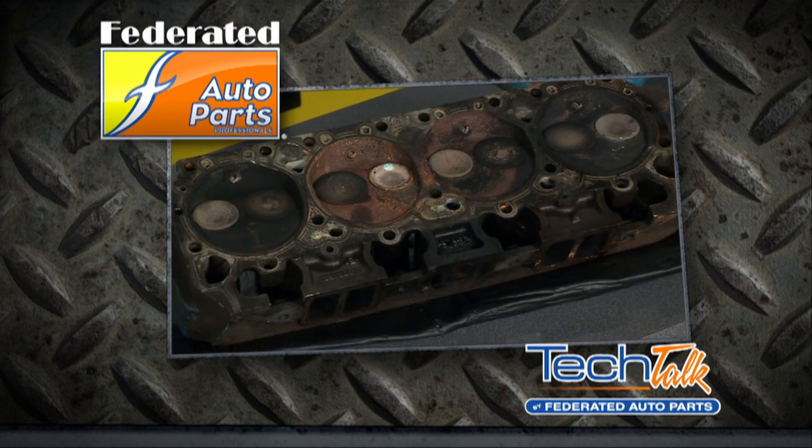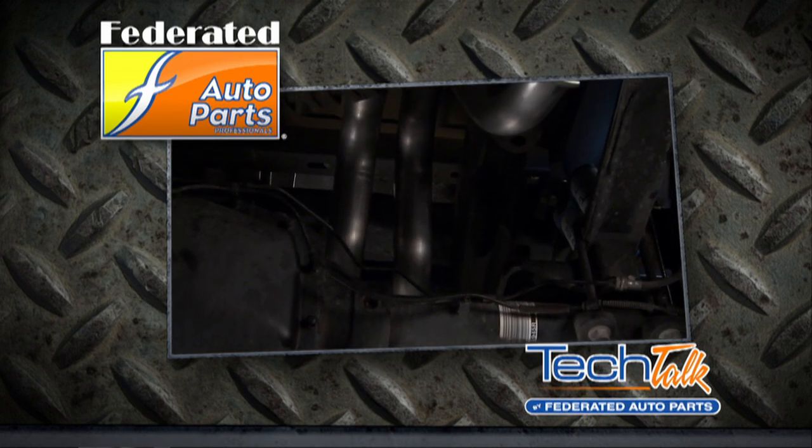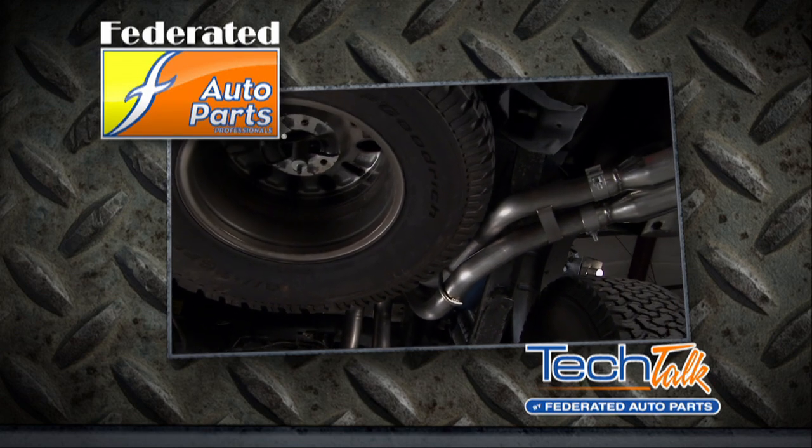So if air is getting past the valve and the valve is in the closed position, there's a problem either with the seat or the valve. We know it's an exhaust valve instead of an intake valve because air is leaking out of the exhaust pipe.